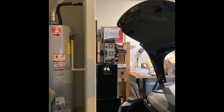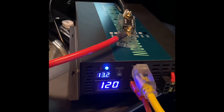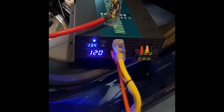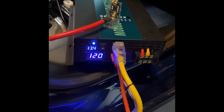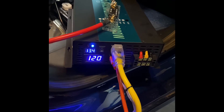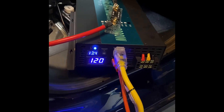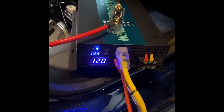The next test is that air conditioner over there — seeing if we can juggle more stuff under 2,000 watts. The idea is to run refrigeration to preserve food and cooling for us, because the South gets hot. Summary so far: Test 1 — powered a full-size refrigerator, peak 1,350 watts inrush, average 127–135 watts. Test 2 — simultaneously ran a fridge and a chest freezer: a 5-cubic-foot Arctic King chest freezer rated at about 50 watts regular and 150 watts peak inrush.